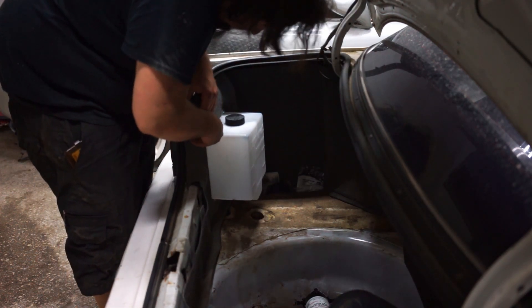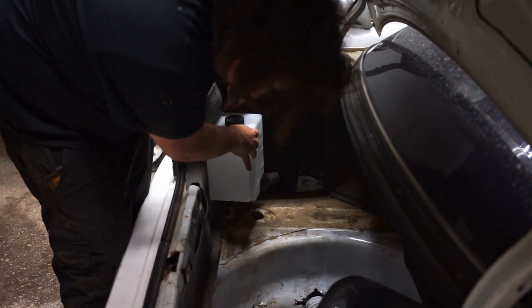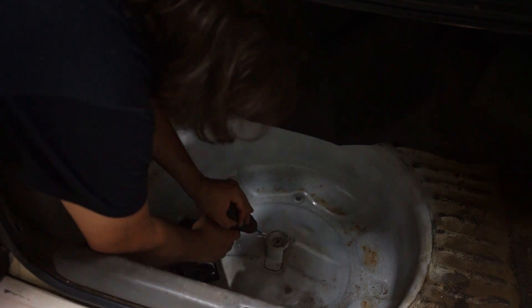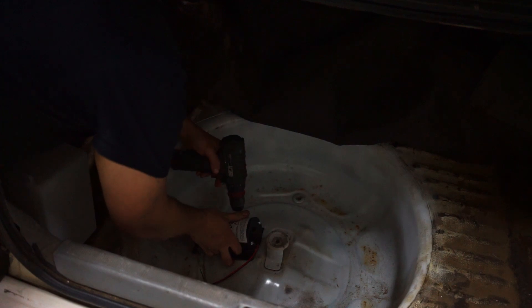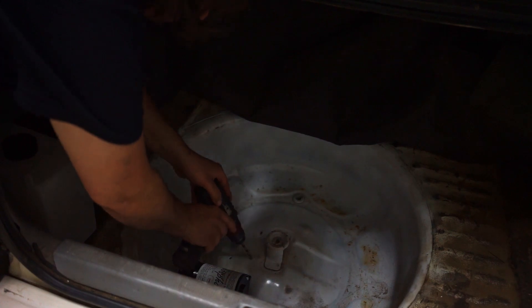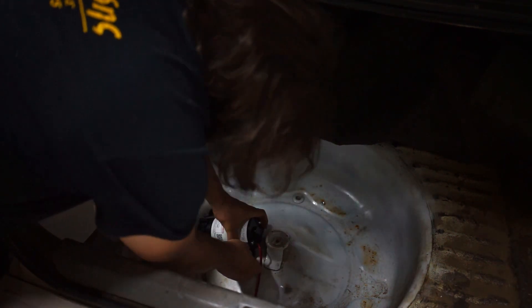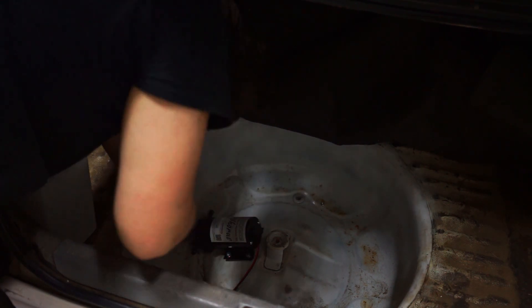That's important because you don't want to spill methanol or water-methanol. While a 50-50 mixture is non-flammable, you still don't want to spill it all over your trunk. Then I'm mounting the pump by drilling a few holes in my trunk floor. If you don't want to do that, well, you're probably going to have to anyway, or you could make a bracket that mounts on the spare tire holder. Make sure that the pump is solidly mounted and that it has anti-vibration feet. Although it doesn't vibrate or make a lot of noise, it's still recommended to use those feet just to keep it suspended.